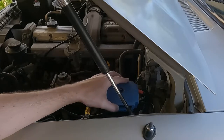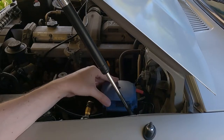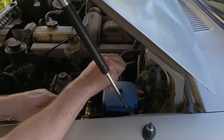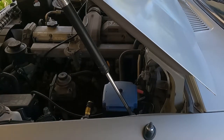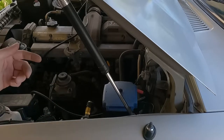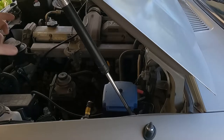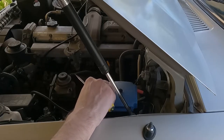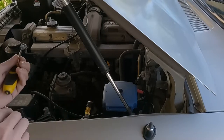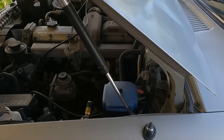When you put the cover on, that's all you see — the wiring coming out of there. I'm going to run it down along the firewall on the other side, work out where I'm going to put the fuse, give it a snip, terminate the other end, put the fuse block in, then work out the other side of that to the battery. Once that's done I'll show you how to program the unit, which is pretty straightforward.